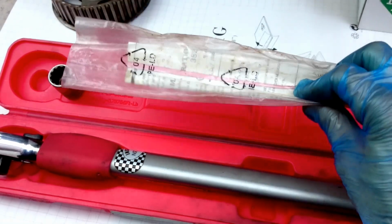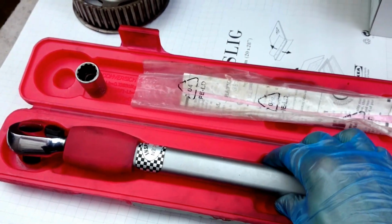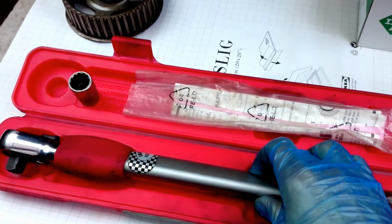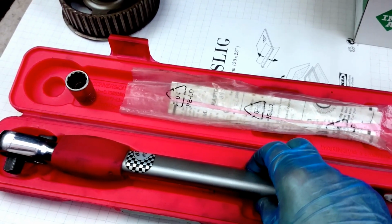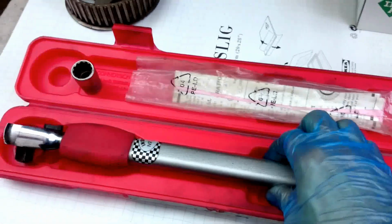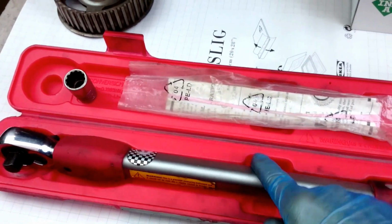Of course, the tool which I use needs to be properly calibrated. With any tools, I've got the actual certificate for calibration. If you use something from somewhere, you never know what the strength will be for a torque, because that's always a lucky dip. The certificate should be not older than 12 months. And in a proper garage, they always have the certificate with the tool, maybe in some bag or in the office. So this tool is properly set.